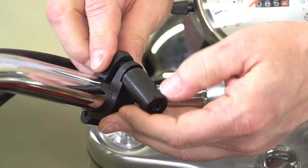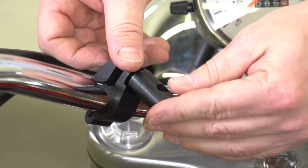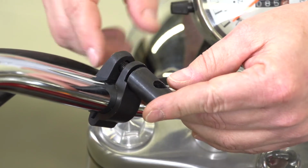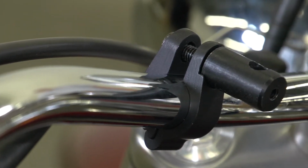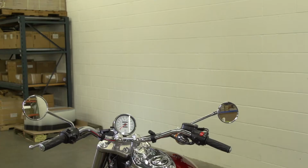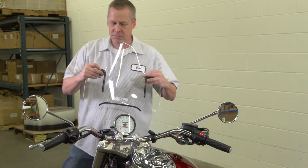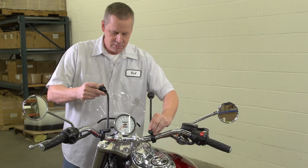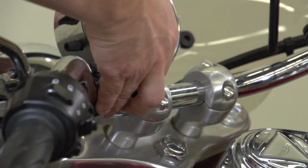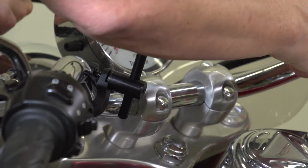The way it's mounted now is barrel set up behind. It can also be set up and flipped around so the barrel's on the front of the bike. Do not tighten them at this point. Wait until the shield is on and positioned correctly before all the final tightening is done. Now remember, before when we mounted the clamps, we mounted them loosely. So now, we put the shield on through the barrels, knowing that the clamps are still loose, so we can make adjustments at this point.